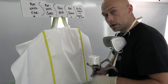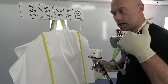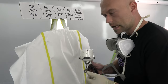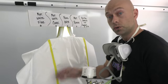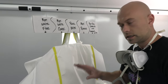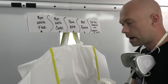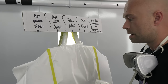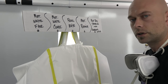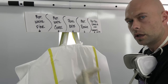That's one coat — I'm faster with my hand speed, a good eight inches off the panel. I'm not trying to get a wet coat of paint because it's just going to cause more problems. All you're trying to do is put this flake down. Each section was about two coats over that white sealer and it looks fantastic — nice and even. That first section I did was dry in less than a minute. If you're lighter with your coats, you're going to have faster tape times and faster dry times, so there's no reason to put that much material on when you already have a color-keyed base.